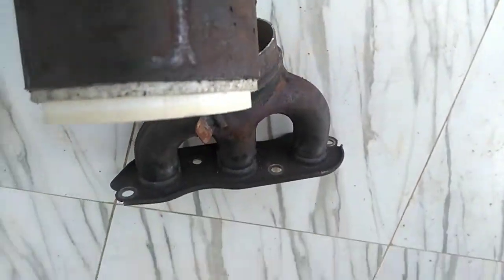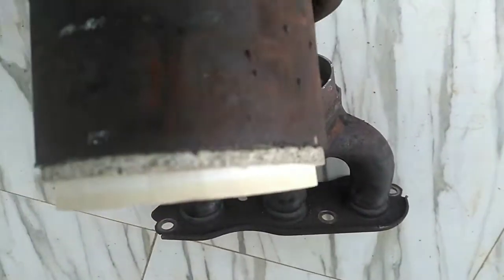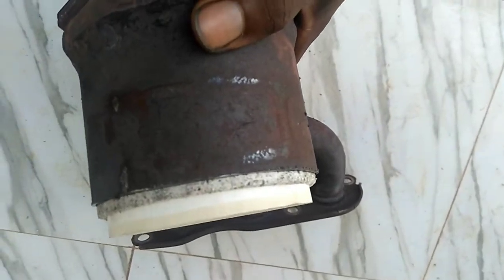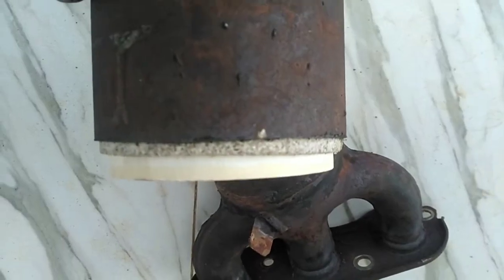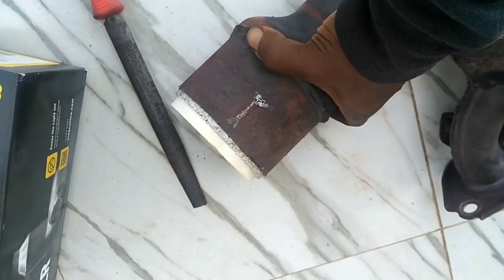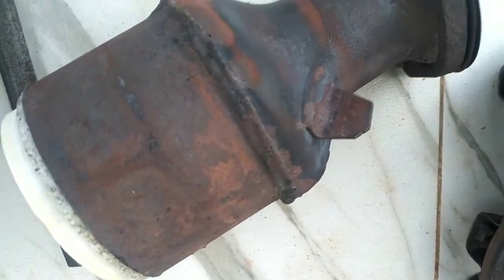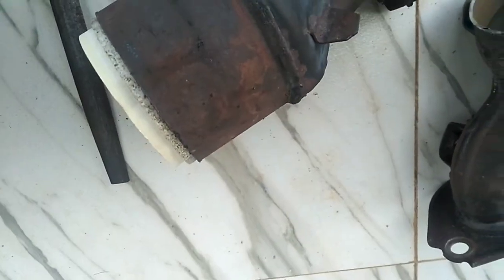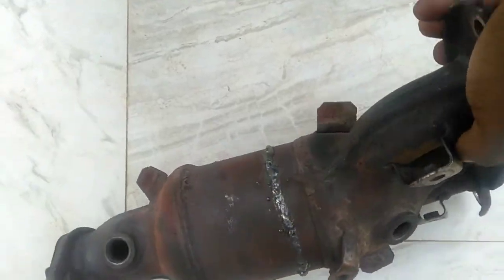After sliding it in, I like to leave some of the substrate material sticking up so that it shields the padding from the welding — so the actual substrate material is shielded from the weld. Next, line up the marks that were made with the upper part of the casing and weld it up. I'll be using a 3/32 inch 6010 electrode with a stick welder. Make sure everything lines up correctly, then reinstall back into the vehicle. After welding, this is what I have — welded all around.